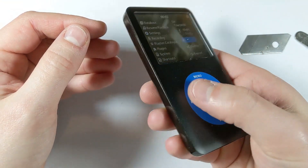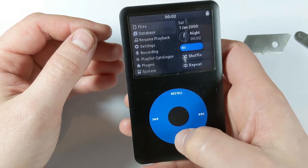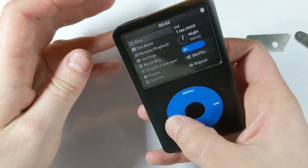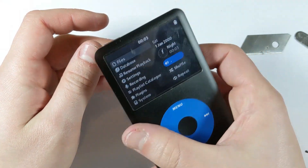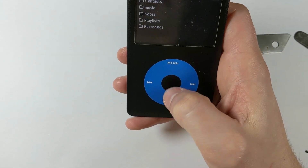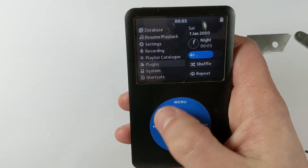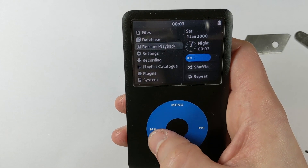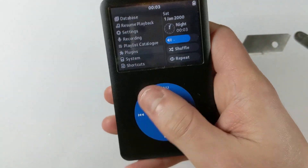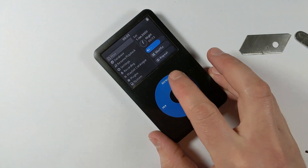Once it's fully sealed up, now we can give it a final test. As you can see, the iPod's making a vibration on each click and you still do get a bit of the sound as well. In terms of how the click actually feels, I'd say it's probably similar to when you're typing on your phone on the keyboard — it's just a very subtle little vibration, nothing too major. It could be stronger — if you want it to be stronger, go for one of those iPhone 7 Taptic Engines. I just wanted to show that the iPhone Mini one is good because you can fit it in the Bluetooth mod as well with all the other mods that people like to do to these things.